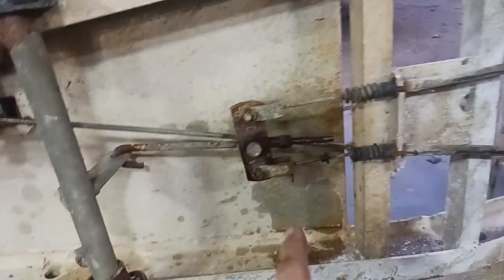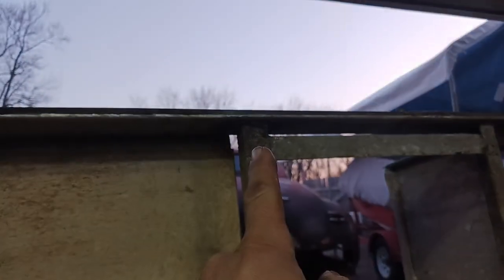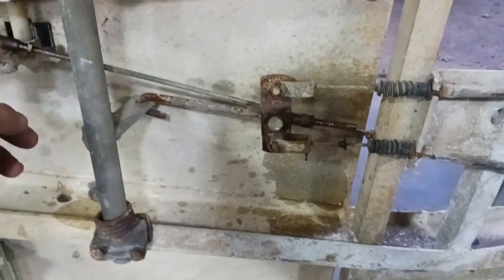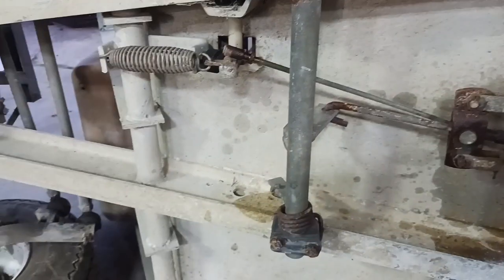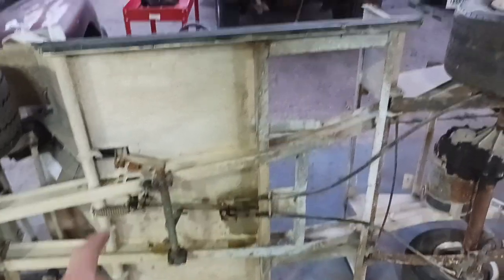I'm going to cut it right here, and right here. I'll disconnect this for the rear brakes so that's all one piece. And then I can unhook my fuel linkage right here for my gas pedal. Later on I can extend this rod — if I want to reuse this rod, I can extend it from the rear back up, make it longer, and still use the existing end. So that's the plan. I'm going to take this off, get these brake lines disconnected, and we're going to cut this thing in half.